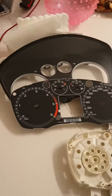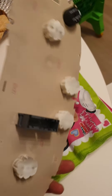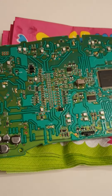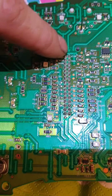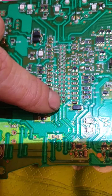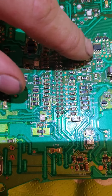The reason I found — I opened the instrument cluster, and here is what I found under the microscope: these connections were cracked, especially at the front. So I soldered all of them from new — this one, those ones.